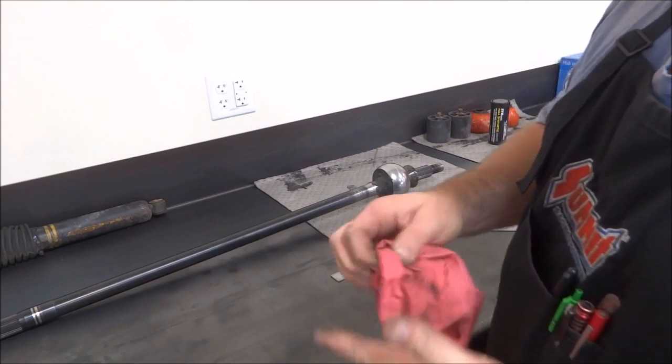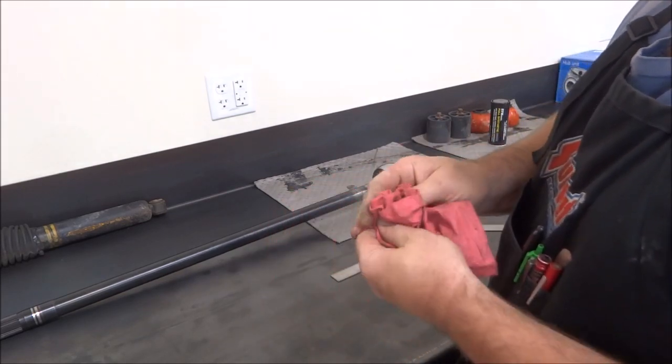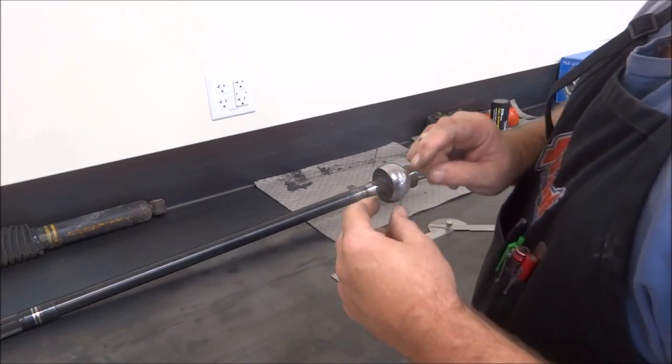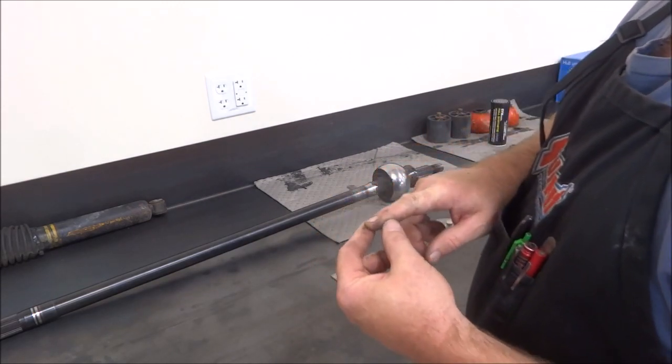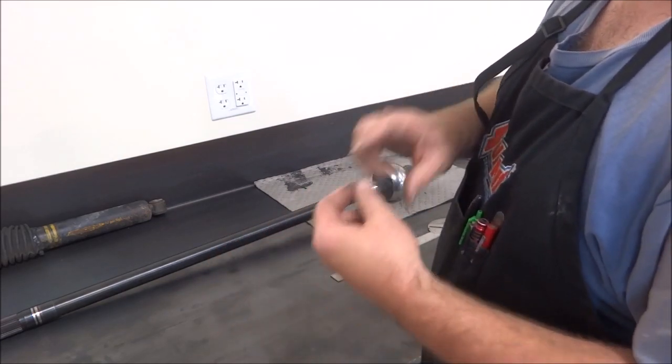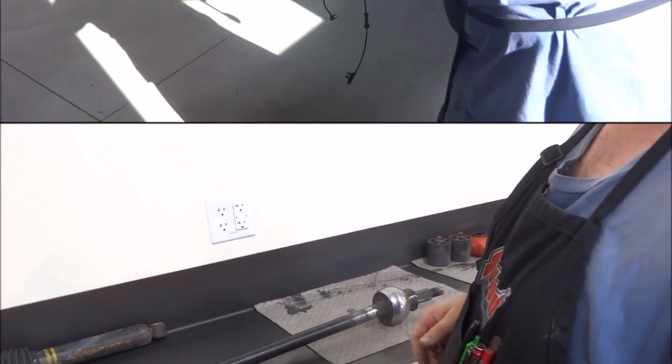You just take, where your stops are on the back, I believe it's a 3/8 bolt, so you take a 9/16 wrench and pop it loose. The nut is spot welded to the threads on the bolt. So just grab it down by the jam nut, back it out, put a washer underneath it, and then I'll remeasure that and see where I'm sitting.